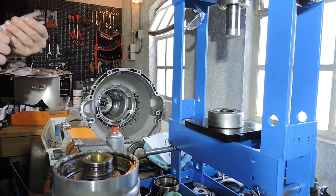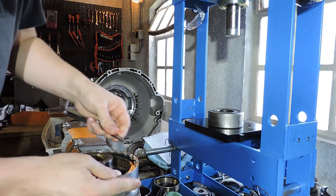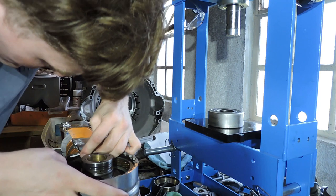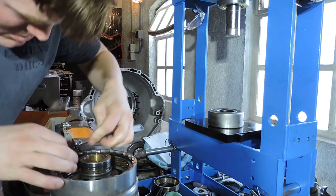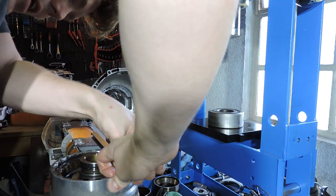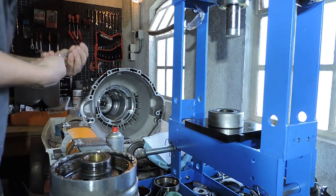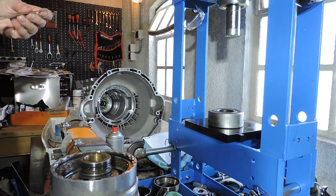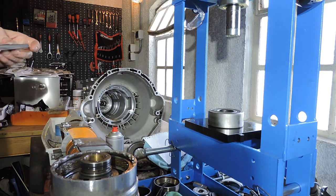And it's exactly the same way as before. We're going to see if we can get that 1.6 in between, and we should not be able to get 1.6 in between. And I can already see I cannot put 1.6 using my fingers, raising my snap ring, pressing down on my steel plate, I cannot get 1.6 in. Now let's go to a 1.3. We're talking 0.3 millimeters here. This is like almost nothing.